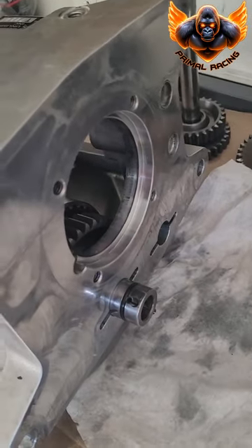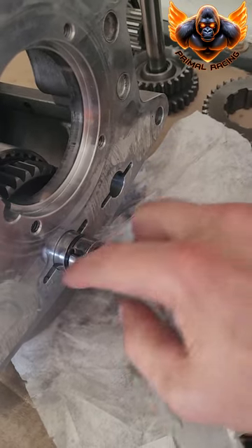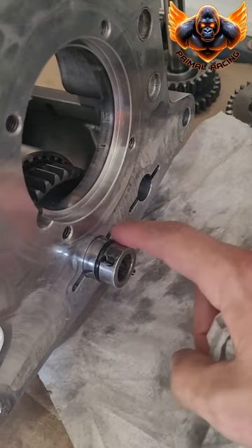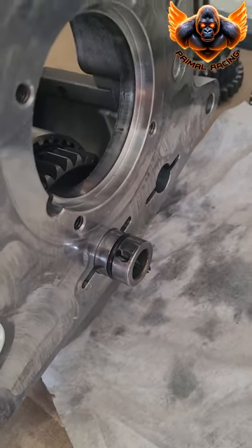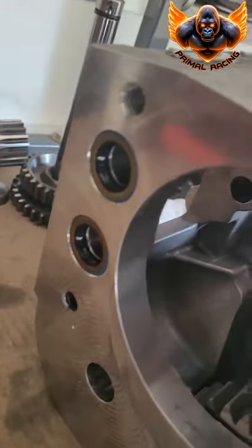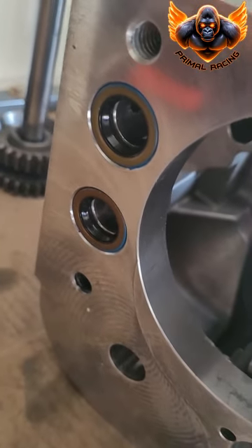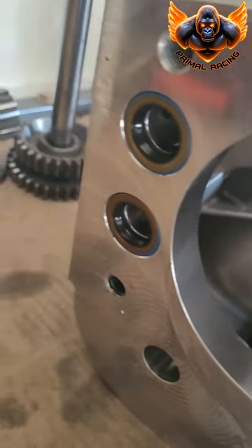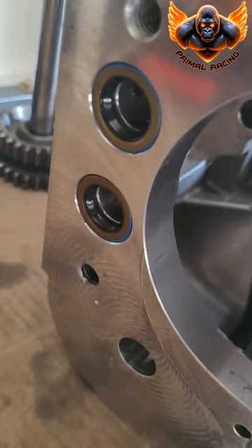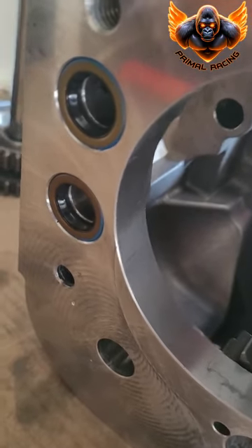One thing I forgot to mention about the cluster shaft: there's an o-ring on here that comes with the kit — you want to replace that to make sure it doesn't leak. The assembly guide asks for petroleum jelly on there to help seal it up. The kit also comes with other seals, but this transmission doesn't have many races on it, so I'm leaving those because they look perfect — not stressed or stretched — so I think they're good to go.